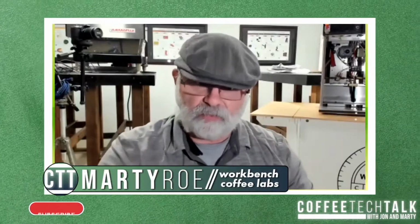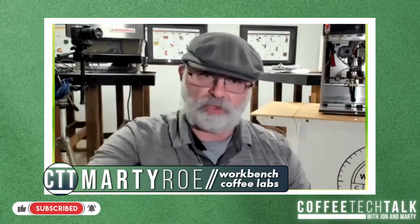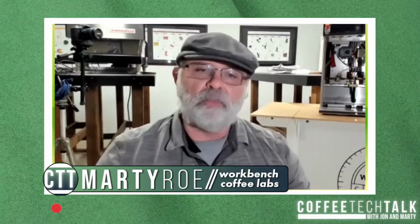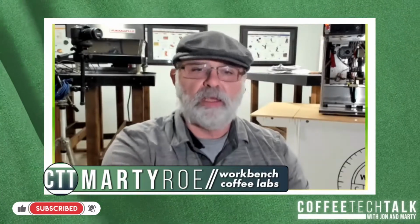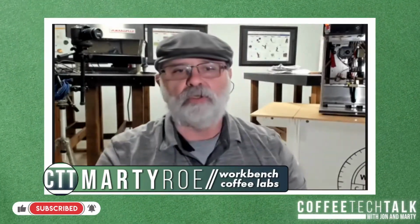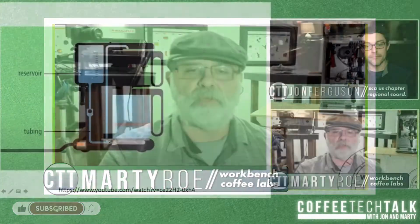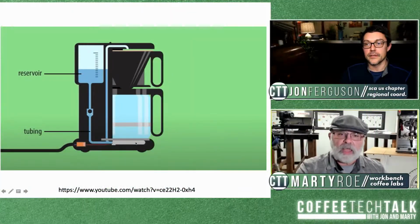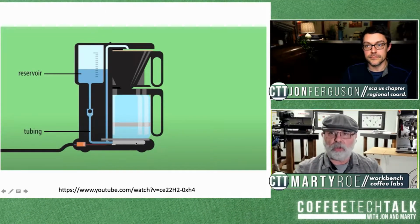So you've got a reservoir, and the coffee or the water is heavy. It wants to drop down. That little ball below it is a check valve that only lets things go one way. And then it goes down. Right. And so then it goes to that heating element underneath your vessel, and that actually heats it up to a boiling point. And it does boil.